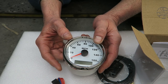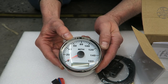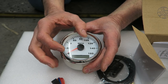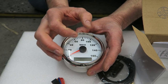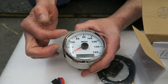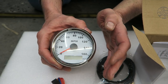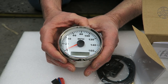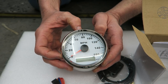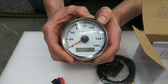I've already got the pulse going on and I've got a little plan to maybe get another cluster - they're in abundance down a scrap yard - just buy another cluster for a couple of quid, then cut out around the speedo keeping the stepper motor still attached to the back of the metalwork. Get one of these clocks and rescale it, and then I'll have a live speedo run off the van, just like the original speedometer. Then if this one goes down I've always got that one as a backup. I might do that anyway, I might not - I'll get this mounted in first.